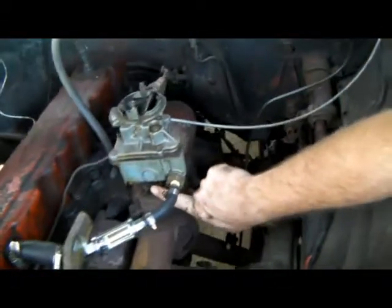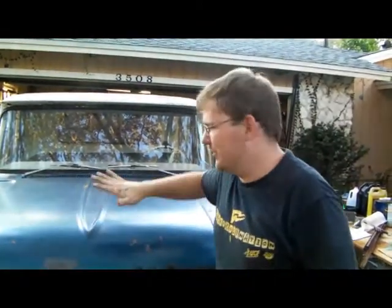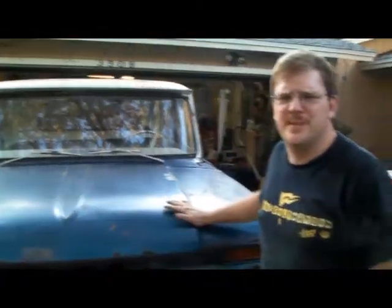The carburetor leaks a little bit right down here. I'm going to do a carburetor rebuild. That's where we hit under here, and then whatever's wrong with the clutch. I have another transmission on the back porch that came out of the parts truck that we're probably going to swap out. It's a Saginaw three-speed, got synchromesh, which is a nice step up from what's here.